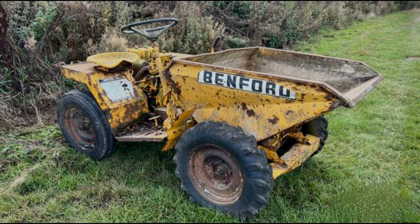Driving around the site delivering concrete blocks was easy, but they wanted me to take concrete from the huge mixer, drive about 400 yards down the road, and dump the load into a shuttered trench. The wheels that steered were at the back. This was good for manoeuvring at slow speed, but driving down the road you had to be careful not to get into an oscillation, with the concrete slurping from side to side. You also couldn't brake too quickly, or you dumped the load on the road.